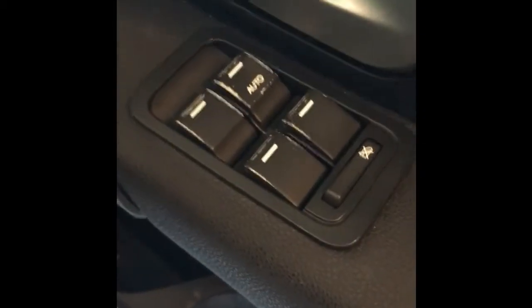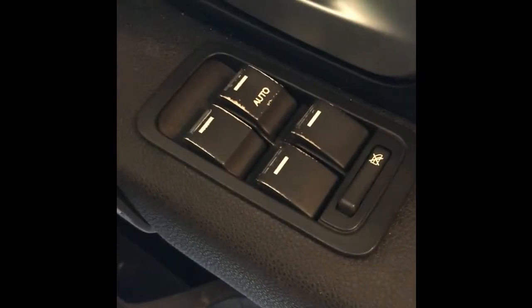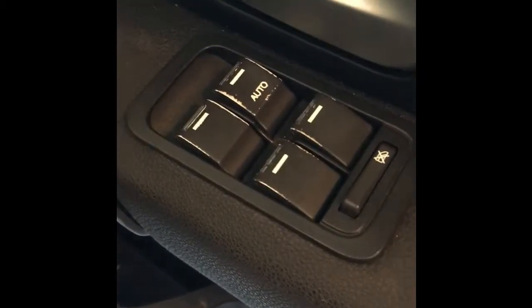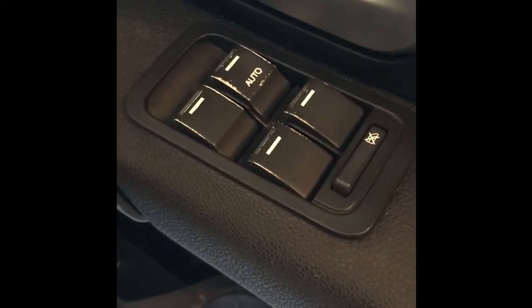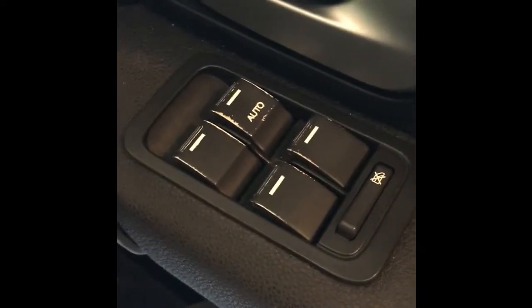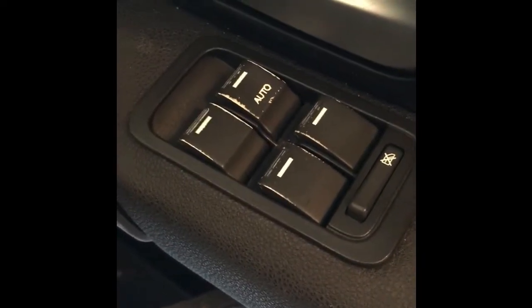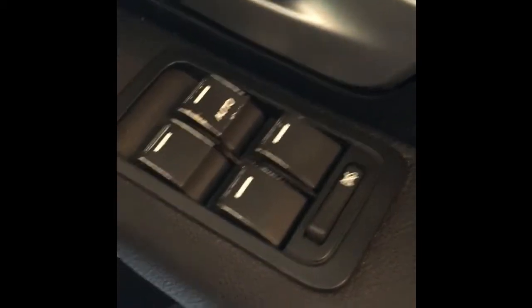This is the existing switch, a bit worn out — the car's got about 78,000 K's on it. What happens is inside these little winder switch contacts, they burn out and get deposits on them that stop them making good electrical contact, and the winders stick or don't work at all — sometimes when you go up, sometimes when you go down.